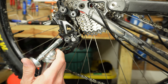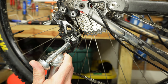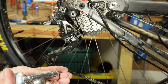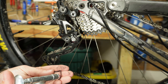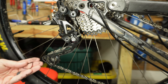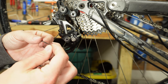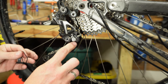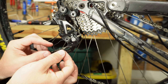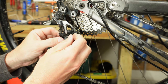To put this back together, I'm going to put a little bit of grease where the gasket goes — just a tiny bit — and sometimes it's easier to just put some grease on the gasket itself to make sure it doesn't dry out. It doesn't take a lot, so just spread it on there nice and evenly. This gasket will only go on one way, so you'll just have to find the orientation. Luckily there are nice sharp lines on part of it so it's easy to line up.